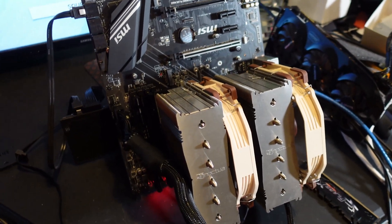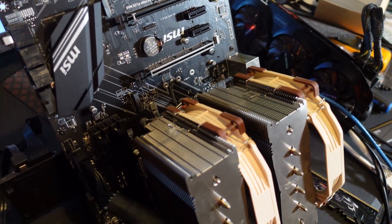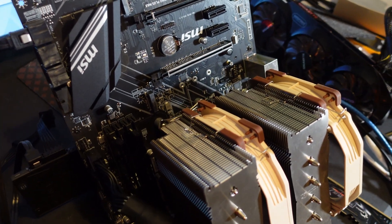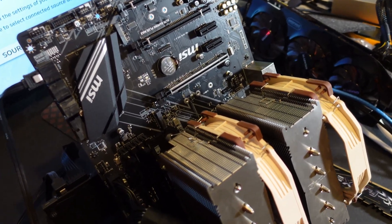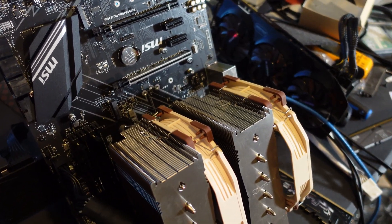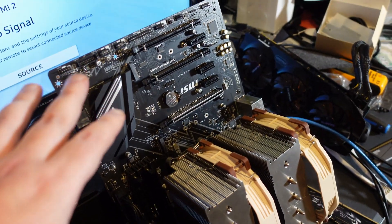Hopefully this helps you figure out some Ryzen 9 3900X RandomX settings - that's your Zeph as well as Monero and other coins that use RandomX. The same hash rate will follow suit on all of those coins for this CPU. I'm glad I got to break my old record. Next time maybe we can get some liquid nitrogen in here - if I could run this at 1.5 volts we might get it a lot higher. Maybe we can break 16 or 16.5 kilohash.